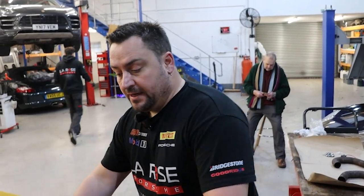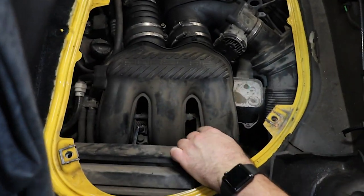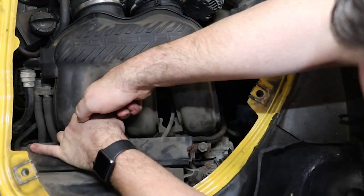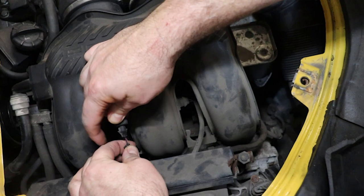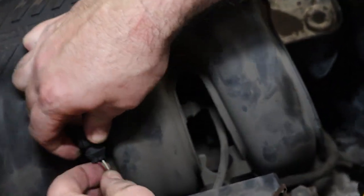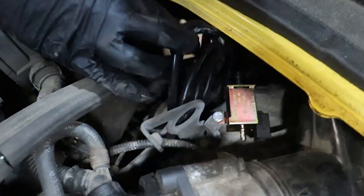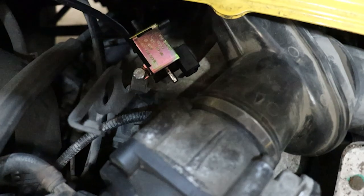What I'm going to show you is where the vacuum valves are that we're going to connect the electrics into. Over here you've got a couple of solenoids. What we're going to do is pop this plug off the solenoid here. As you can see, there are two wires — a red-blue and a white one. What we're going to be doing is plumbing our positive feed off the red-blue wire. Where we tend to connect the vacuum solenoid is the engine lifting eye over here.